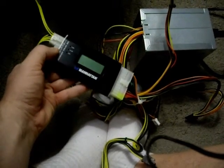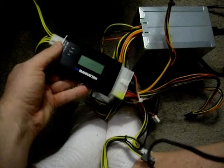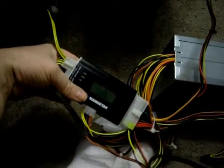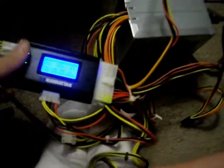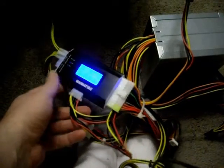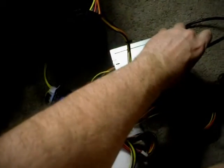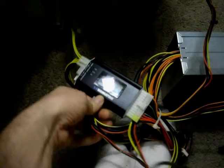I'm going to go ahead and pause it real quick. Now I've got the bottom connector connected with a four-pin power connector from the power supply. I'm going to go ahead and restart the power supply — turn on the switch. I've still got my load up here. It beeps twice again to let me know. I have my readings, all of them within tolerance. So this particular pin is good. Now I'll power it off again and plug in a SATA to check that one.